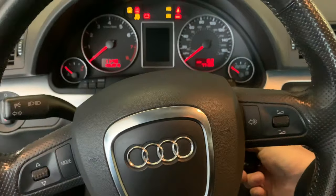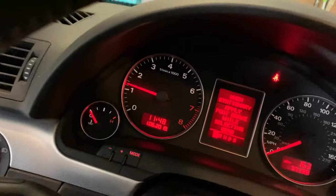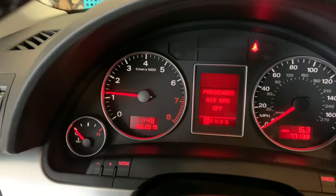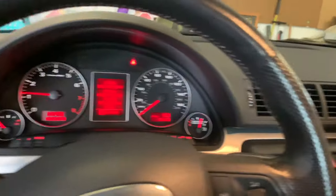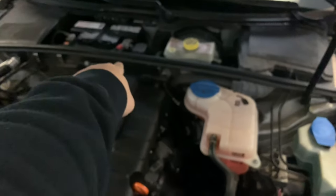So let's fire this sucker up. What I thought it was was lifter noise. I also noticed that the car was having a little trouble firing up — I actually had to kind of crank it over. Another telltale sign is that it's idling a little high; it should probably be closer to 700 or 800 RPM, not 1100 or 1200. It's not feeling like it's running rough right now, but that was also something I noticed, and it seems to happen when it's really cold out. If we pop the hood, the problem is right back here.